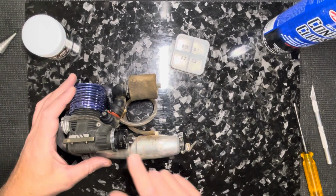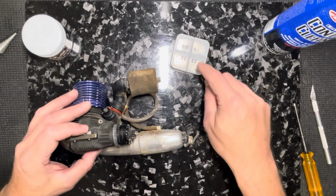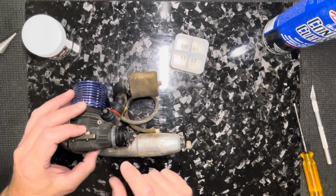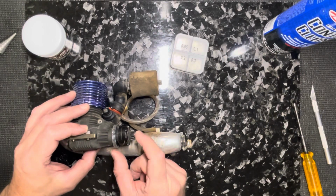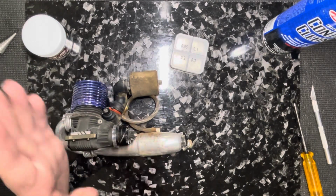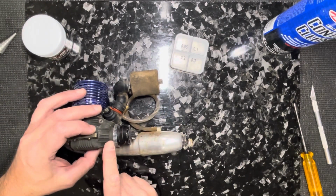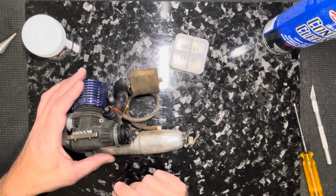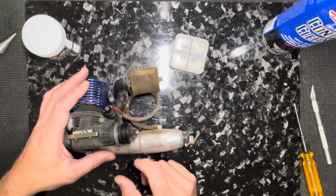You also want to make sure your flywheel is shimmed properly also. We just released a flywheel shim pack today that's the same precision as this, so you can get your flywheel perfectly positioned, meaning it's perfect in your slot for your chassis to start it easy, and it also makes sure that you can line up the clutch bell with the spur gear perfectly in line, not off a little bit. Because there's been a lot of cars that I've ran over the years where you have to shim back here to line this up perfectly, but they don't give you the shims. So it's always been kind of a pain in the butt to find them. They're a little bit different size than normal, but we just came out with that today.